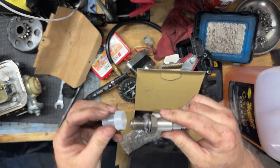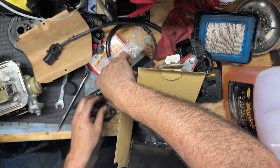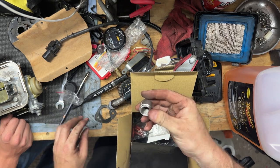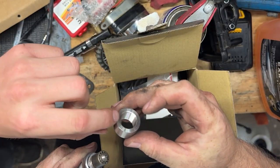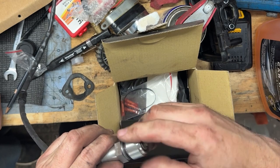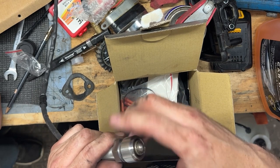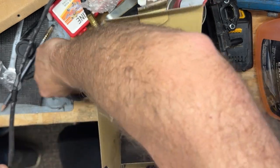It's looking good. But it needs the bung, which has got to be in here as well. Your bung. Is that it? That's it. I imagine we just got to drill a hole that this end fits through. Probably drill a hole that this sits in. That sits in. Yep. You're right. And then this will drill on that way. And then that just barely pokes into the exhaust manifold. So we got to drill a stepped hole that's as big as this. Which, we got step bits, so it shouldn't be hard.